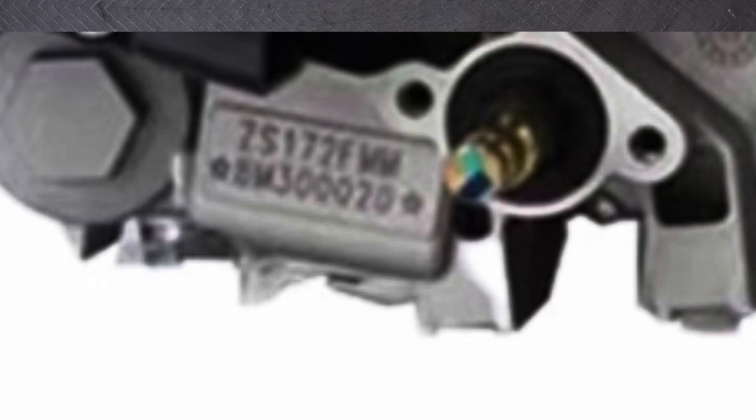First off, there's a lot of scams out there. Make sure you order it from the right place — you can get the engine right now from X-Pro, but make sure the serial number does match. What you're looking for is ZS172. That's how you know you have the true Zongshen 250cc engine. ZS stands for Zongshen. The first number means one cylinder, and the 72 means the diameter of the cylinder in millimeters. And then off to the side you're going to see a 3A — that's the engine you want for an off-road bike.